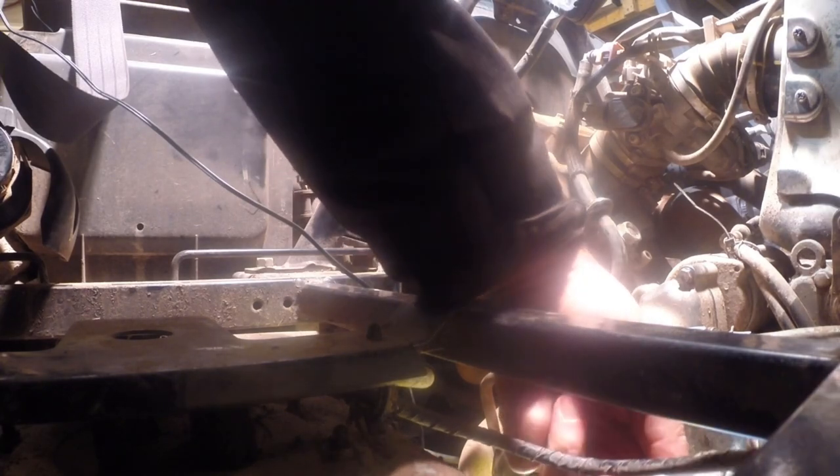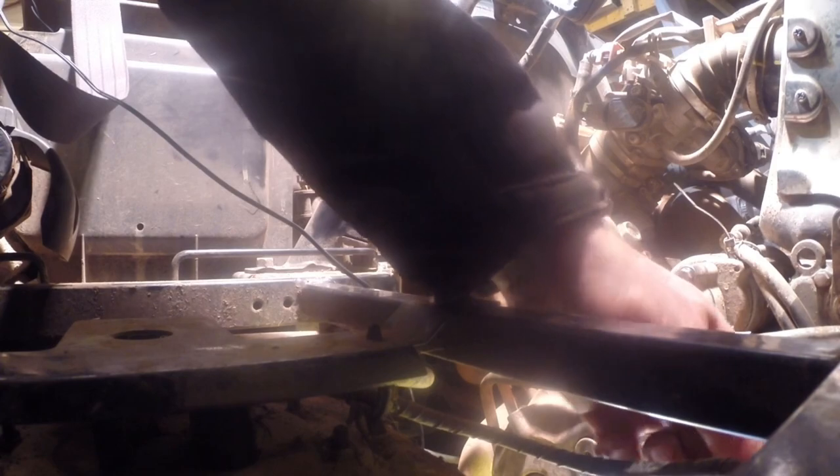So now I'm going to connect our new stator windings and redo that test - I'm expecting 14 and a half volts or so. I'll start it up and do our final measurement. We're at 12.2, 12.3, 12.4 volts - what's happening right now is this alternator is charging a discharged battery. Now 12.6, so it's climbing quickly. After it ran for about 10 minutes it's just over 14.1 volts. Anywhere from 13 to 14 and a half is good, and that tells us that we've fully resolved the problem.